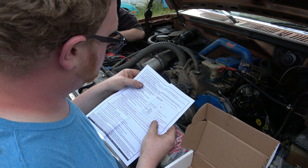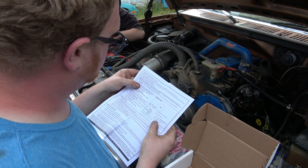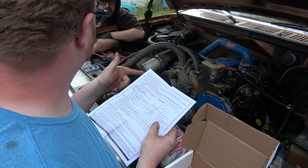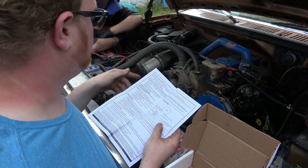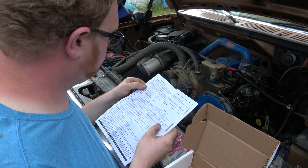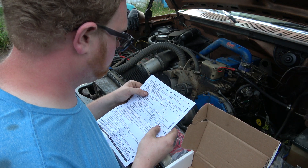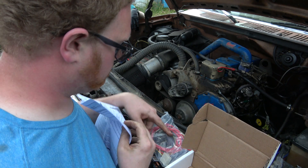So, AC override: using the blue wire tap provided, attach the green wire to the positive lead on the air conditioning compressor. That's how you hook it up. But I already have a wire set up for the AC circuit, so when that comes on it'll send a signal to this guy here. We're just going to re-tap into that. So the green wire here is our AC turn-on.